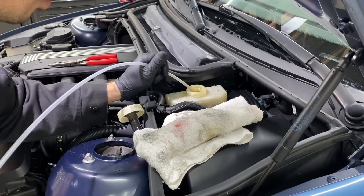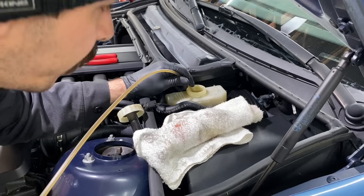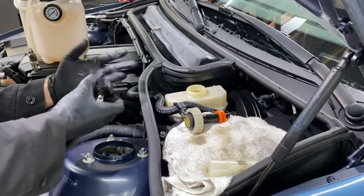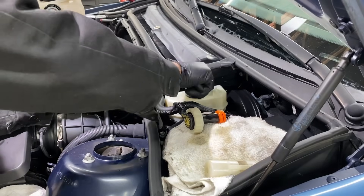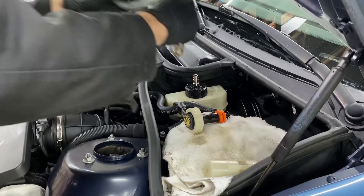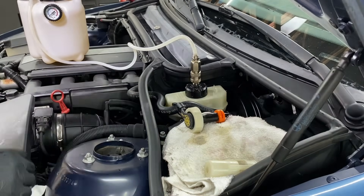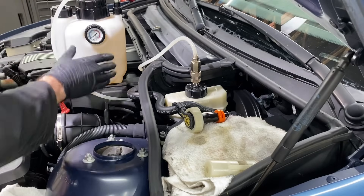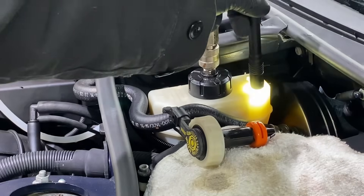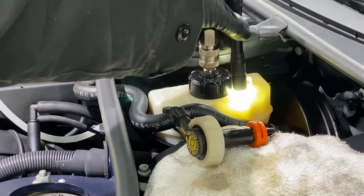Some people like to evacuate the reservoir. I'm going to pull a little bit of fluid just to show you, but I never really like to drain it too far because you can introduce an air bubble into your system. At this point, you can top it off with fresh fluid and begin the gravity bleed, but I'm just going to put my fitting on and attach my brake bleeder tool. We're going to put about 30 PSI into the system. After attaching the brake bleeder tool, it filled the bottle back up to our mark, so it'll regulate the fluid level for you.